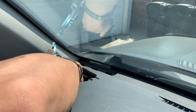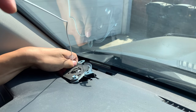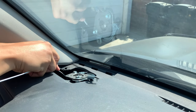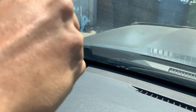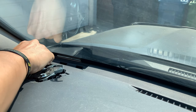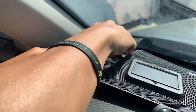I'm feeling this area to see where I can run the wire through. I'm gonna take a clothes hanger and hook it all the way through. You can either go through the A-pillar or you can go through the hole that it has behind the speaker — I'm gonna go through this area. I'm going to attach the line to the clothes hanger and use some tape to tape it up so that it's gonna feed through. I'm gonna go ahead and feed this line until it gets all the way through. As I fed it through, I'm gonna go ahead and remove the clothes hanger now.